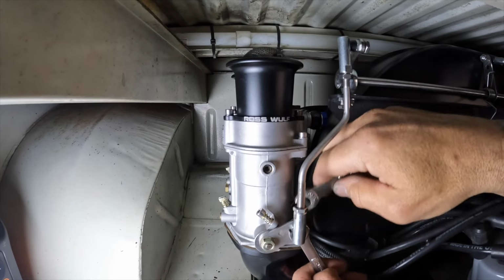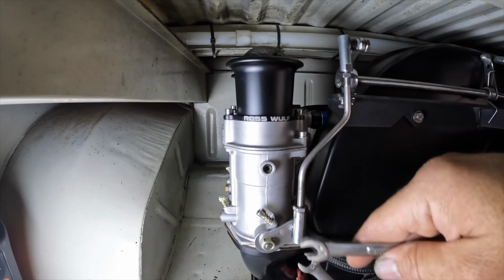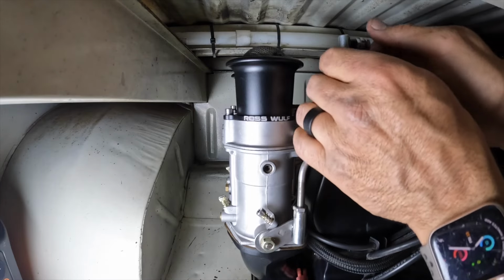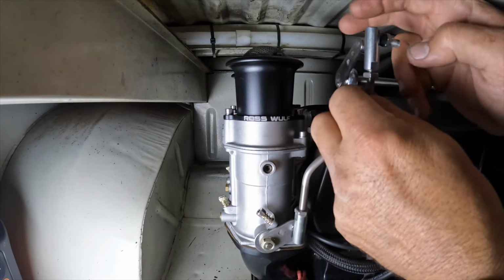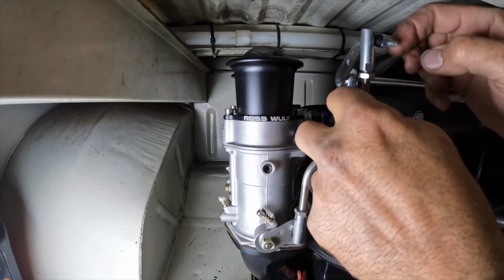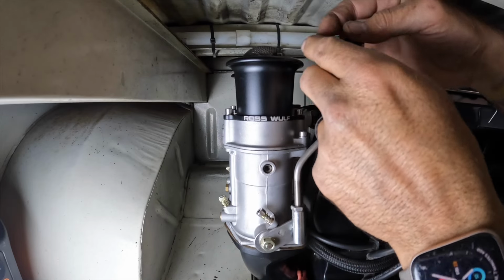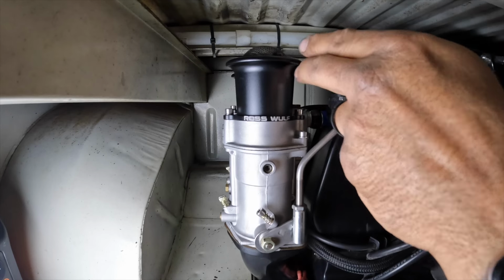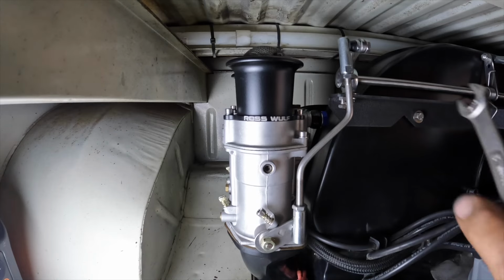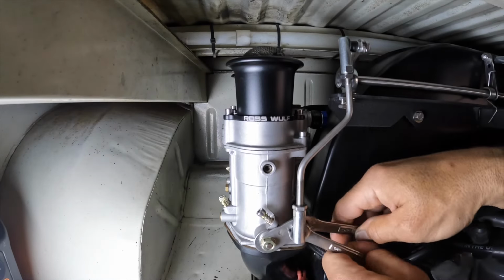So I got to tighten those up quite a bit. Once I put that in the proper location on the exterior of that top arm, I got to turn those things in two turns each on each of these. And I am still hitting that shroud, so we're gonna take that top one off and give it one more rotation inward. Okay, when I say inward, we're gonna shorten it up one. So we're bringing it in one full turn. It still needs more. We're gonna take it another turn. Right there. So when I bring it in, now I've got my air gap back over there. And we're bedded nice and deep on that top one as well. Don't bother me at all. Got that one tightened, and I've got that one tightened.